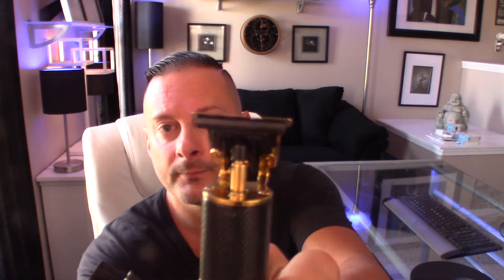With other razors or clippers there's a mechanism that's not really exposed. With this, the whole thing's exposed. When you turn it on, that middle piece spins — there's kind of a metal attachment on there which is off-center, and that's what basically spins, comes in contact with the blade, and moves the blade back and forth. This does have a combination of stainless steel and ceramic blade. Nice thing about these: they don't require as much lubrication and they wear really well.